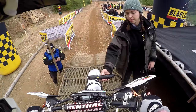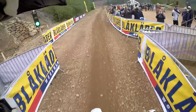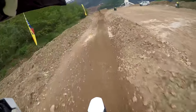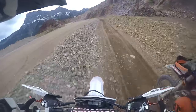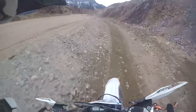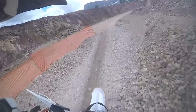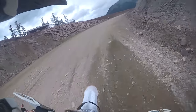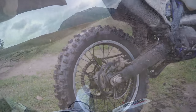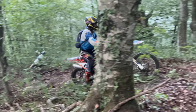For really fast, high-speed riding I suggest higher tire pressure, because you need a completely stable dirt bike so your suspension can work properly. If you ride at low pressure, your dirt bike will be very unstable, which is very dangerous. In this video you can see the prologue qualification at Erzberg Rodeo — pressure in my rear tire was about 0.8 to 1.0 bar, because speeds are up to 150 kilometers per hour and you need a stable bike. If you use extremely low tire pressure, you have to use two rim locks to prevent damage. If you use more pressure, then one rim lock is enough.